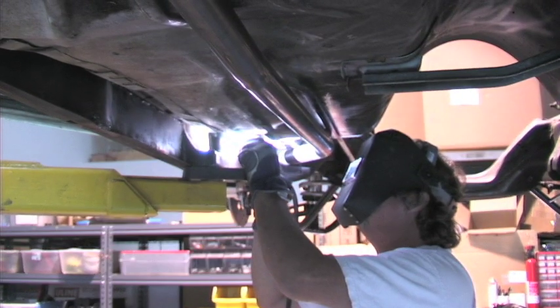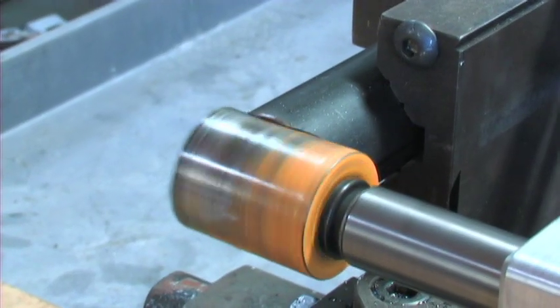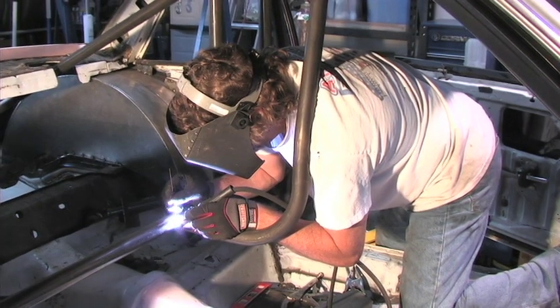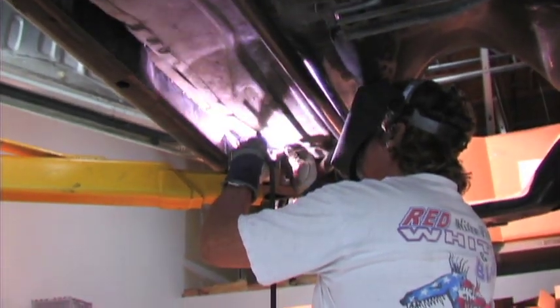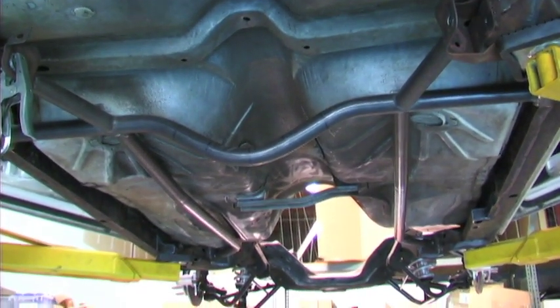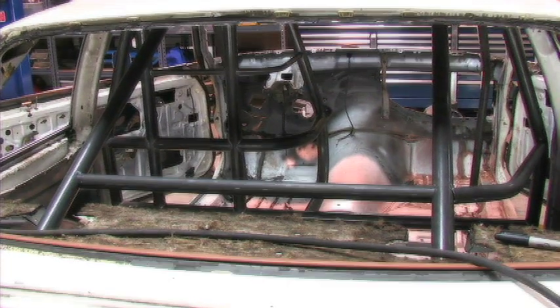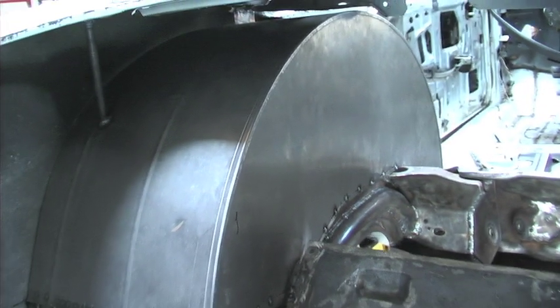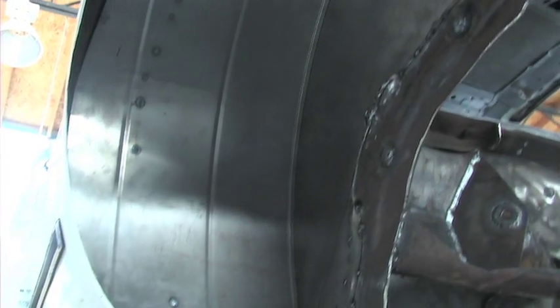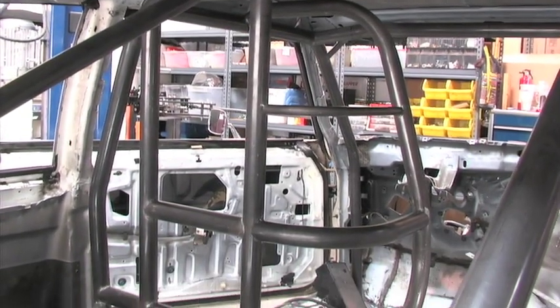The only thing that remained was the SFI 25.5 requirements within the floor. To be SFI legal in a perimeter frame car like the G-Body, we would need to add two inner frame rails inside the stock outer rails. In addition, a complete chrome moly cross member would connect the inner frame rails and outer frames into one solid structure, preventing collapse in case of an impact. So with the help of Chassis Engineering and Simpson, that pretty much wraps up our Grandma G-Body chassis. You'll see us add a few more bars to the underside of the car, including an X between the frame rails, but most of our work is done.